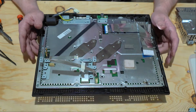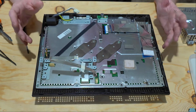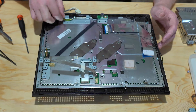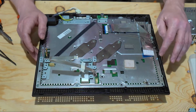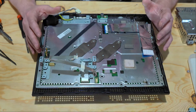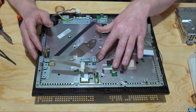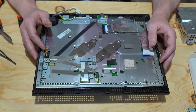Now we're getting ready to go ahead and remove the screws that take the main board off — the motherboard. Before we do that, there is this one here, I believe it's a ground cable — we need to remove it, and then just remove the screws from the outer edges. The whole board will pull up; you're going to have to finagle it a little bit. Sometimes there's even a popping sound — don't be scared of it. We're also going to pull out these little pressure plates that hold the heatsink to the GPU CPU chipset.